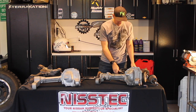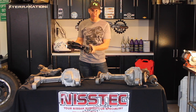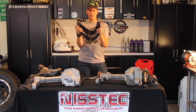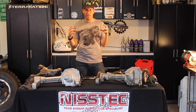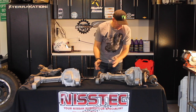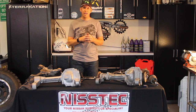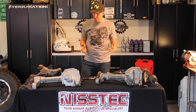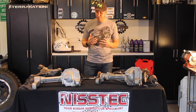One more thing — if you notice when I held these up, the Titans are exactly the same width. This is the Titan and the Frontier upper control arms: they're the same width, the same mounting points, everything except the Titan's longer. So you can actually swap the suspension straight into a Nissan Frontier or Xterra and it will all bolt straight in. All the mounting points for the differentials are the same, and that's how you get a larger, stronger suspension. You could even go buy junkyard parts — though there are now many manufacturers making upgraded components for the Titan swap at a much better performance level.